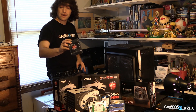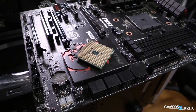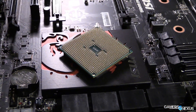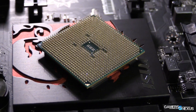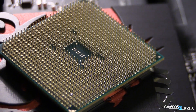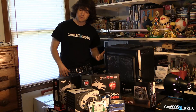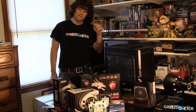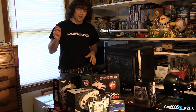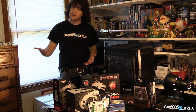For the CPU we've got an AMD Athlon X4 760K. Some of you may know the Athlon line from way back during the X64 days. This is AMD's new Athlon, which is basically just an APU with no IGP — they've dropped the graphics chip. It's based on the Richland APU, and because it's Richland it's going to perform a little bit better on the CPU side than Kaveri does.